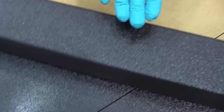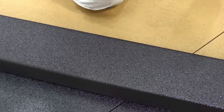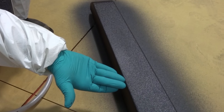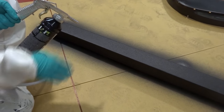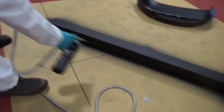When we come back we should be able to gently touch it and turn my hand over and there shouldn't be any black. When I touch it now I'm getting that on my finger, but when I come back in half an hour my finger should be clean. When that's clean it's about ready for the second coat. I'm not damaging the Raptor and I'm not getting any material on my fingers — this has been left for about half an hour. On this one I'm going to leave the air pressure the same as before, but you can adjust the air pressure and the distance, which can give you different textures. Away we go — second coat.